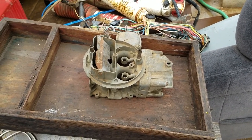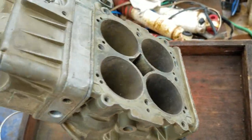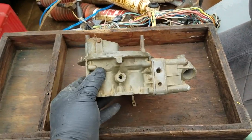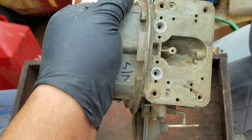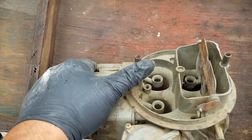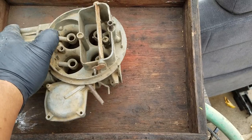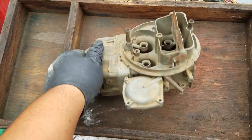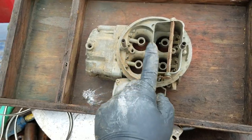Welcome to the Nightclub guys, it's your host Night Wrencher. I got my hands on this Holley 780 vacuum secondary carburetor, and it's not in terrible shape — it's actually in pretty good shape. What's special about this carburetor is that it has down-leg boosters, which are supposed to give you a much better signal than traditional boosters. They came in a lot of OEM cars, and I'm going to try to restore this and get it ready to work on the LS.